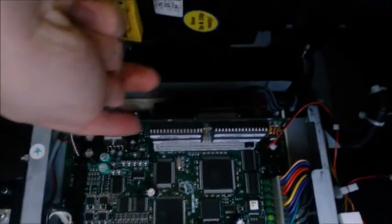You remove your game card from the MPU. So this is your game card. You pull that, put it down, not on metal. Whatever you do, you put it on a bit of wood, turn it back on. Your machine will no longer do anything, it'll just flash away. But you need to go to your note reader, check that the red light has come on.